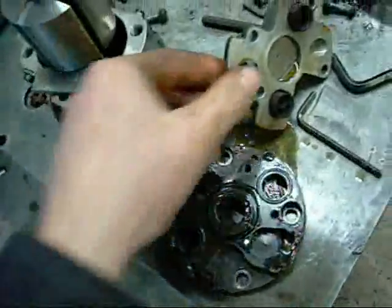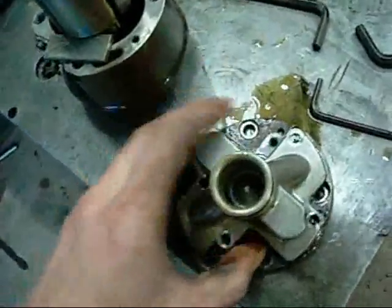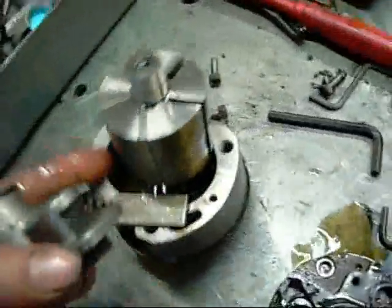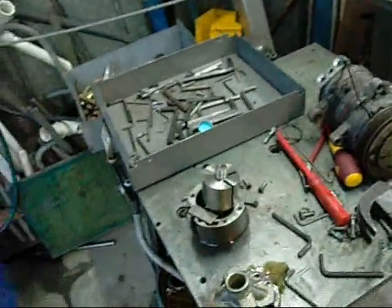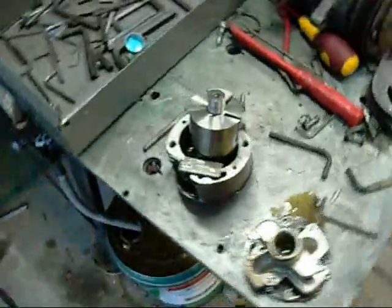That's the valve side. Suction screens, suction inlets and 2 discharges. Both sides of the chamber work as a discharge and suction point. So effectively it probably has the same sort of capacity as a 2-cylinder reciprocating pump, which isn't a bad thing.